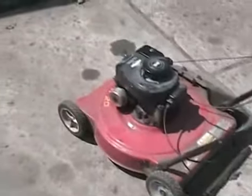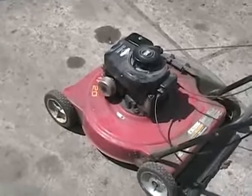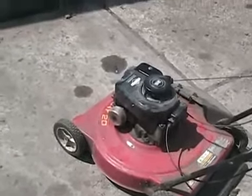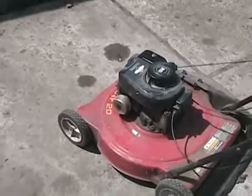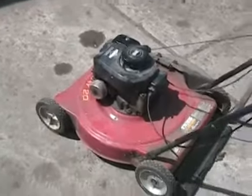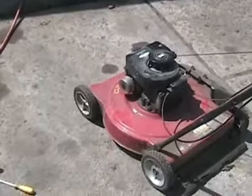Well, if you go to start your engine immediately after you've stood it up from being tipped over, the oil that's in that spring chamber will blow up through the PCV tube and get blown right into the carburetor, choke the engine out, make all kinds of blue smoke, coat your spark plug, and even fill the air cleaner up with oil, and then cause it to run too rich because it's got too much suction with a clogged air filter. This is such a common thing. I think almost every person who has a lawnmower has done this.